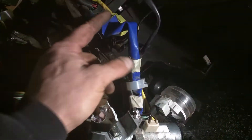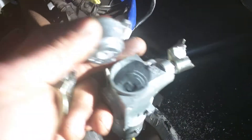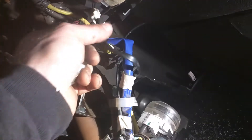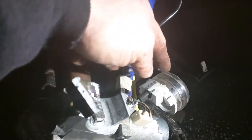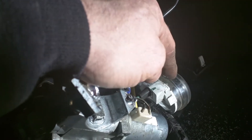After that, you just have the blue one we are going to reuse — that's the one that goes to starting the car. This black one here is actually the one that does a ding ding ding when you have the key in the car, so if you just want to remove the ding ding, just unplug this. That one will go anyway. The last one is just the light — when you open the door, it sends the light here, so we'll disconnect that black connector as well.